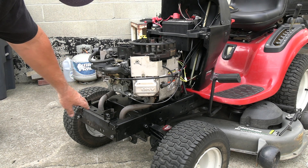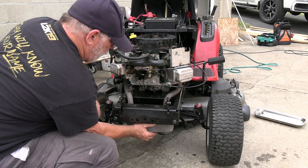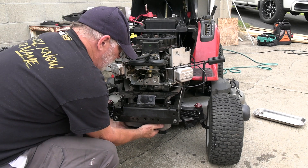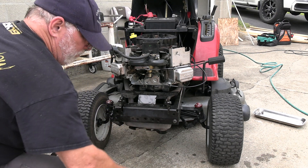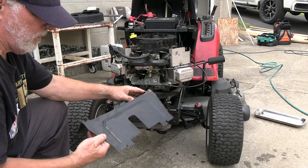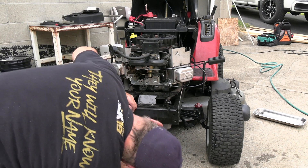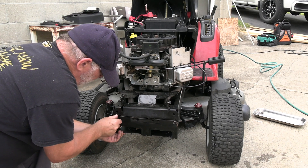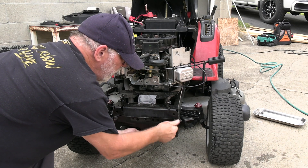Now I'm going to go ahead and shove the exhaust back on there and put the plates back on. When you put the muffler on, slide it up into the holes — slide these tubes into the holes. Wiggle it, it'll go on. Put your plate on. When you hold your muffler, put your bolts in. Now I'm going to take these bolts back out — that's where I put them so I know where they were. It's got these hooks on there. Take these hooks, put them on there just like that, bring it up here and bolt it down. If you look up under there, you'll see those holes for those hooks. Get these started and run them in.